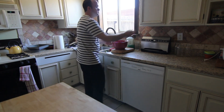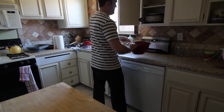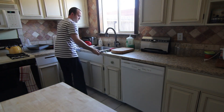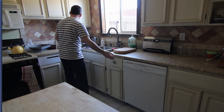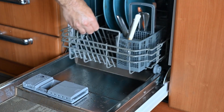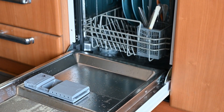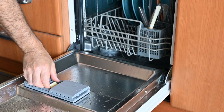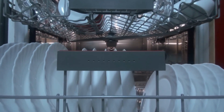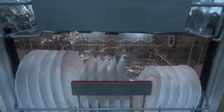The dangers of using the wrong voltage. If you plug your dishwasher into a voltage lower than its requirement, it won't receive enough power to function properly. It might not clean your dishes thoroughly, and you'll end up with disappointing results. Also, the motor may draw more current and trip the circuit breaker, and there's a potential danger of motor burnout. On the other hand, plugging the dishwasher into a higher voltage outlet can be even more problematic. The excess voltage can damage the appliance's electrical components and motor, leading to costly repairs or even rendering it irreparable.